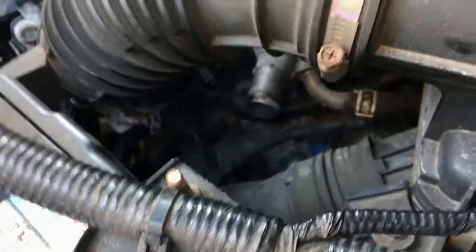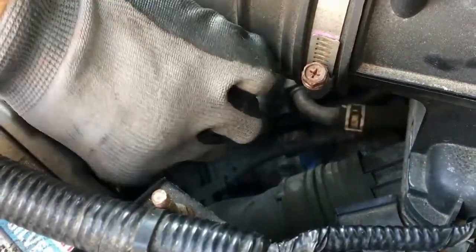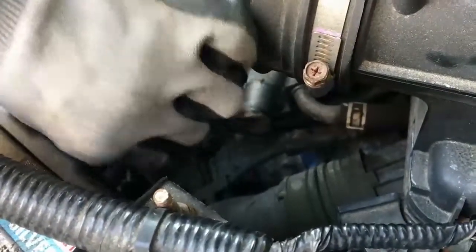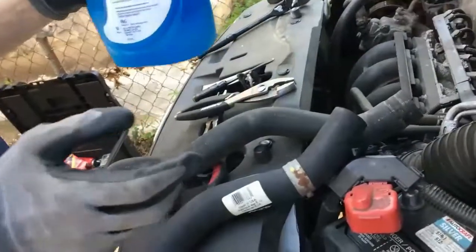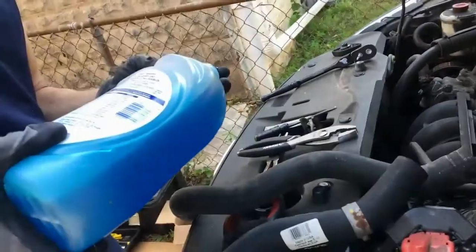There's a groove that this hose will have to slip over, okay? And you want the clamp to slip over that groove here. It gives you a wide amount of space with which to put your clamp on, probably a good 1.25 inches there. But to slip it over there, whenever that situation arises, I put a little bit of detergent inside, and any dishwashing detergent is fine.